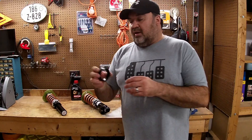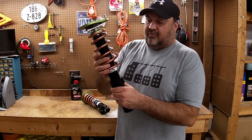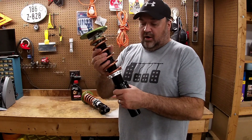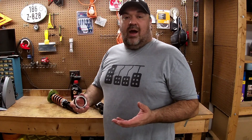What's cool about the front is it comes with these sleeves that slide over the coil, so you can actually raise up the front a little higher if necessary. You can get the proper amount of travel depending on what you're doing with the car and how you want your suspension to perform. I'm going to try it without the sleeves first and see what happens.